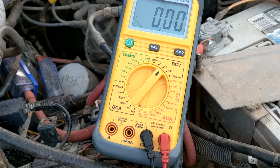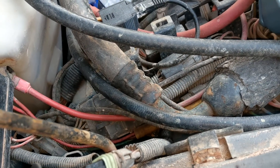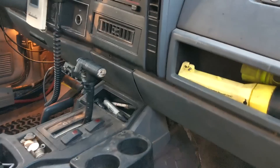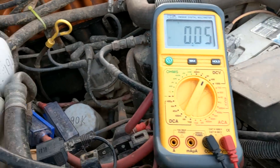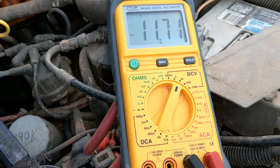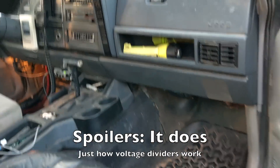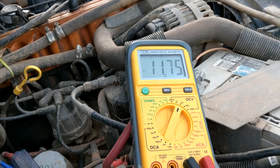I still kind of want to look at that resistor. I want to see if the resistor is working properly, so we'll check this at the fan. We'll go positive to negative and check each setting. On high we're getting 11.76 volts - that's nearly what was coming out of the fuse, so the drop is decent. We go to medium two and check the voltage - still the same thing. We might not get a voltage drop without a load. Still the same voltage on each setting - that was a bust.